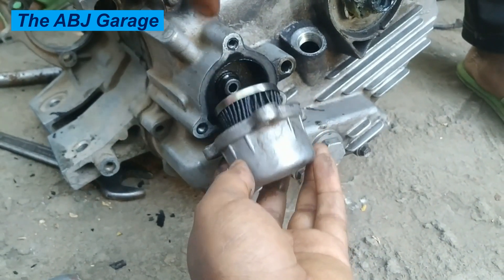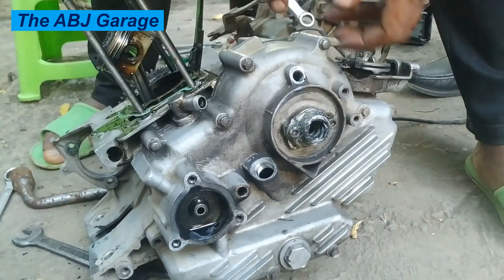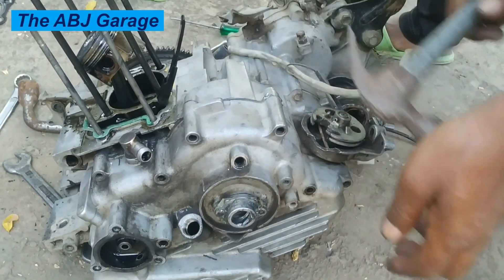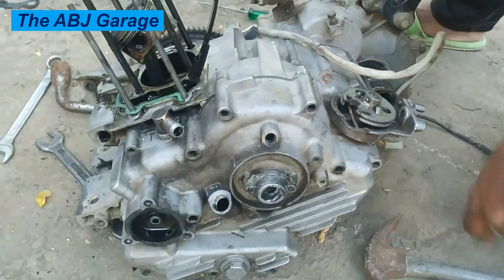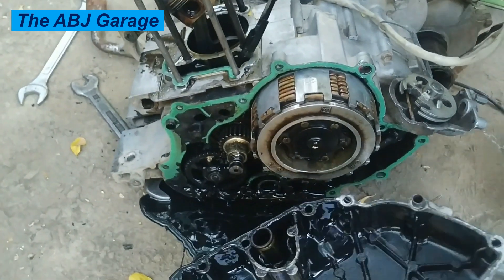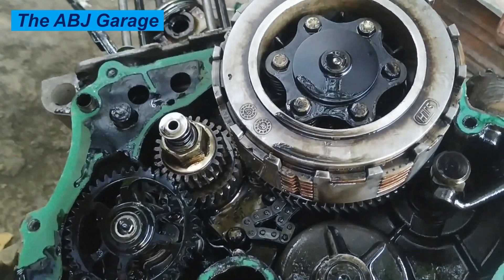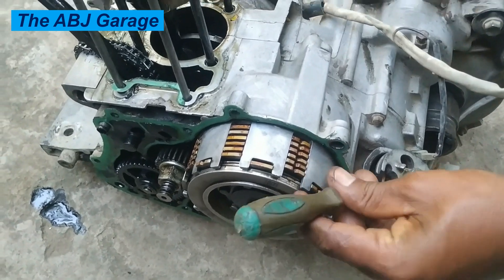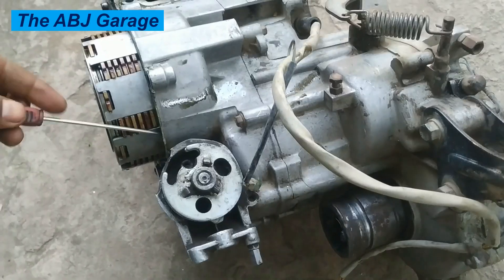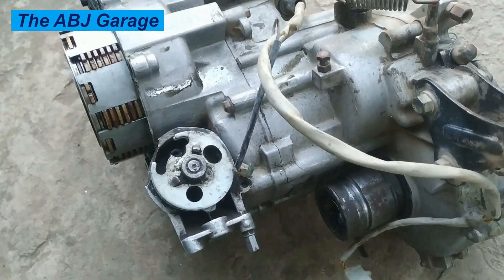When opened, there is an O-ring on the housing — make sure the O-ring is there. With the oil filter assembly removed, go ahead and remove the clutch-side crankcase. Try tapping it lightly with a soft punch to loosen it, then insert a flat-head screwdriver and pry it open. Here you can see the clutch assembly, the oil pump, the crankshaft, and the crankshaft drive for the timing chain. There is also a gear selector mechanism visible.